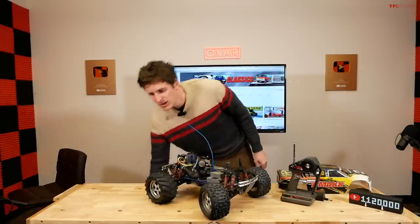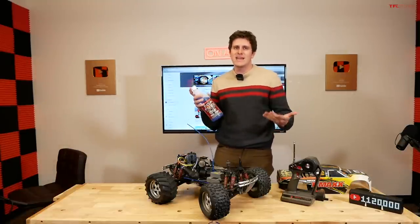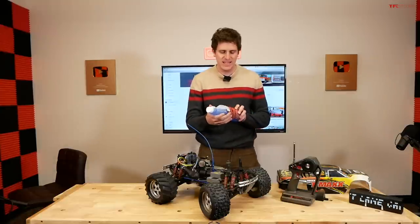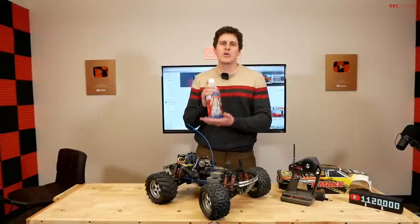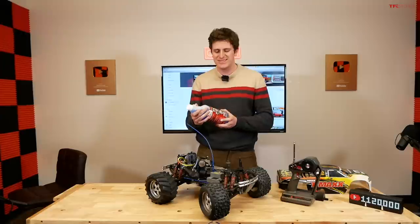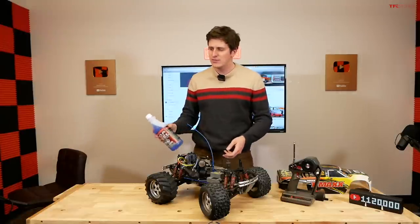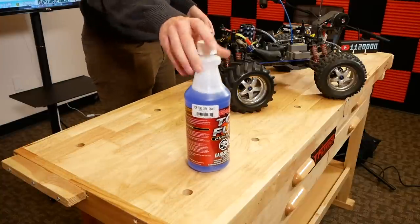Now, first of all, you need nitro fuel. And I just purchased all this stuff because I didn't have it from back in the day, and it was shockingly expensive, the number of things I had to get. So this is the Traxxas top fuel. Once again, this is nitro methane mixed with methanol, and you can get it in various percentage mixes. This, I believe, is 20%, but you can get it between like 20 and 40%, depending on your preference. Now, this is one quart, and it cost me over $15.